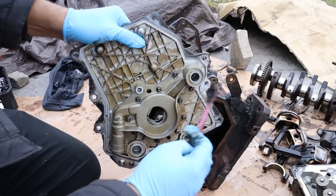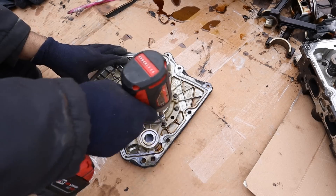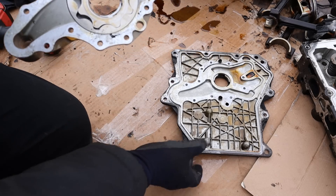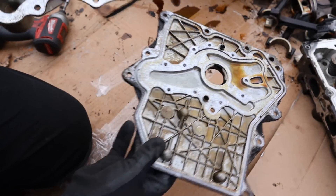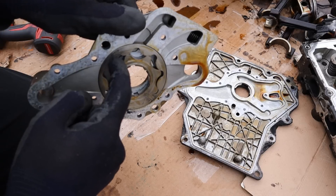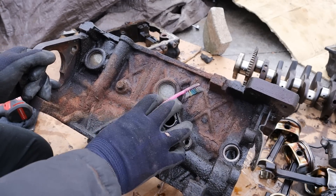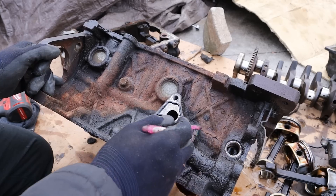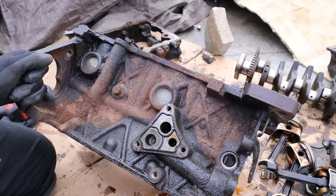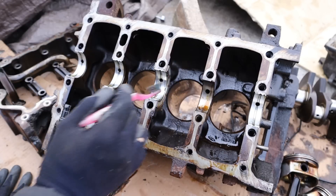You can see the inlet and outlet over here — it's going to create that fluid flow and then send it through the oil galley inside of the block. Let's take a quick look inside of this oil pump. You can see there are a lot of wear marks inside the pump rotor that rub up against the housing, which also has some wear marks. Essentially this draws oil in, fills this cavity, and as it rotates with the crankshaft it squeezes that oil to the outlet. Oil from the oil pump is then sent over to the oil filter housing where it gets filtered, and then sent down into the galley that runs along the length of the block. There's also a small branch that comes off to pick up oil to lubricate the head. The crankshaft is lubricated through holes that are drilled down to tap into the oil galley running along the length of the block.